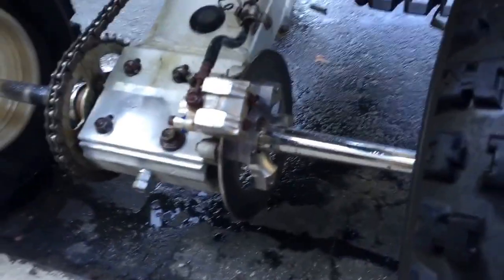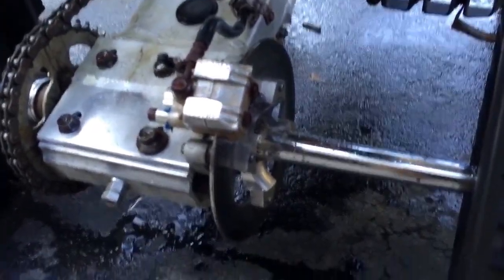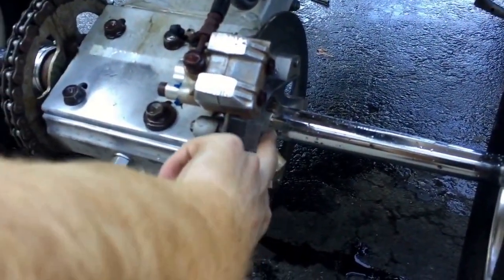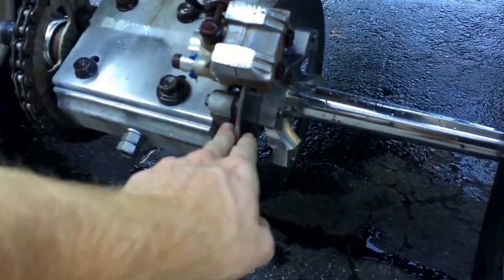Sorry I had to take a break and get the kids fed and everything. But once you screw this on to your plate, you can mount your caliper back onto your rotor. And then just reverse order — slide the tire back on. If you've got spacers, put those on. Then your locking nut and your cotter key.